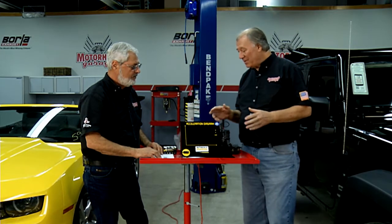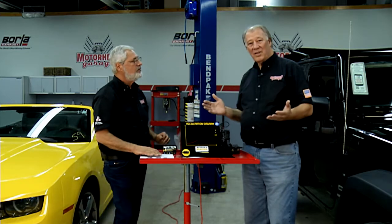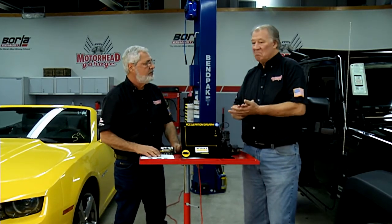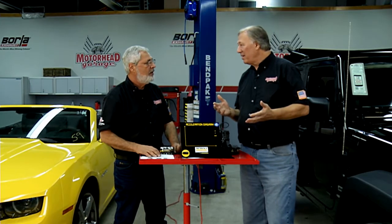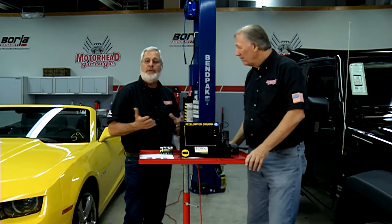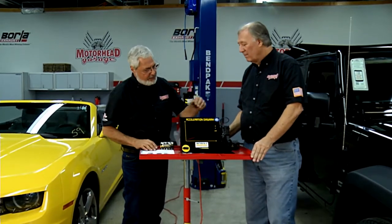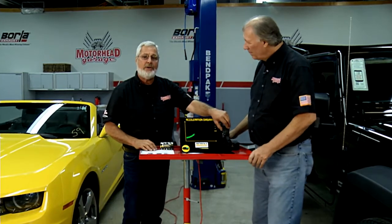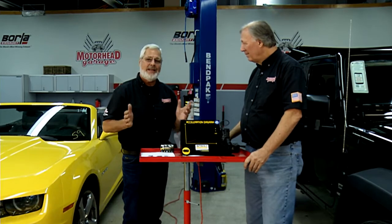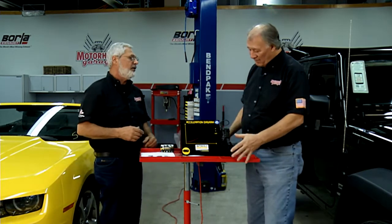And Sam, this is something that I never thought much about. Today's cars all have an electronic throttle, but when you put your foot down on it, it accelerates away. You don't think much about it, do you? Right, but it's a computer controlling how fast that throttle plate opens with a DC electric bidirectional motor. That gets a signal from the throttle position sensor, which is now mounted on the throttle pedal. You step down on it, and as hard or fast as you push it doesn't matter. The computer still does what it wants to do, and here's a great way to show how slow that is.